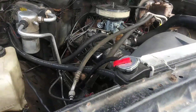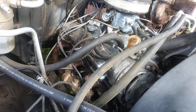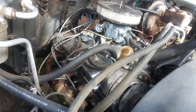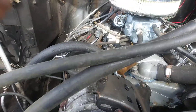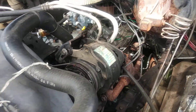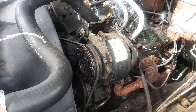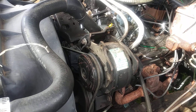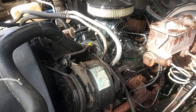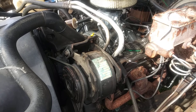But this is the motor. To some, they see junk. But for those that know what to look for, they know it's not junk. It's a 357 — it's 40 over on the bottom end. I thought it was a 350 when I bought the truck, but it was a 355 the whole time. It had them GM Goodwrench valve covers on it, and it is a four-bolt main block when I busted it down and put it back together.